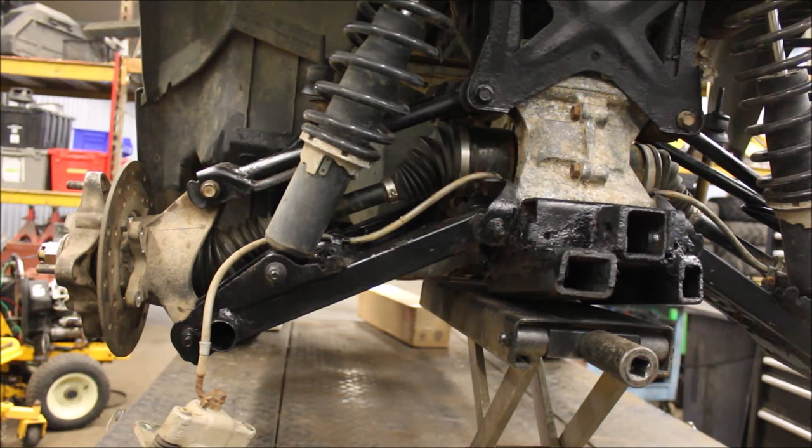All right, so this thing came with turf mode. And here's a warning to you guys. If you have an ATV with turf mode, or even a UTV for that matter, I see a lot of guys that just drive in turf mode, meaning the center of the transmission disengages one axle from the other, so only one axle is spinning and the other axle is freewheeling. So if you drive on grass, you don't tear up your lawn.